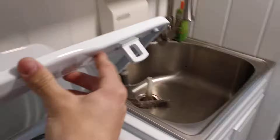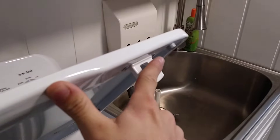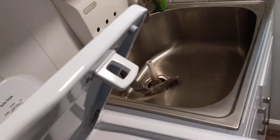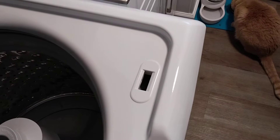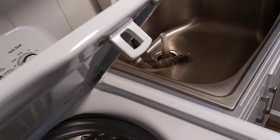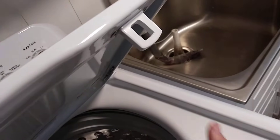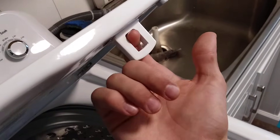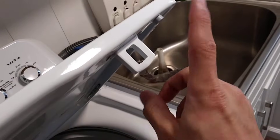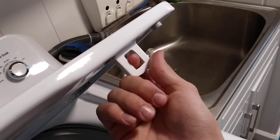This is a GE GTW 465, and on some models depending on how old it is, you may either have a fixed static piece like this or a spring-loaded latch which can move up and down. The principles of how to get this device off the lid and get it to work are the same. This component is either magnetic or there is some sort of sensor which is able to detect when it is present — in this case, this is a magnet.